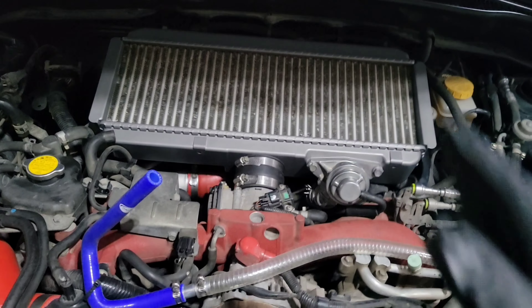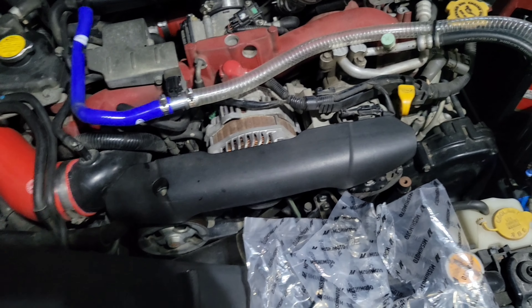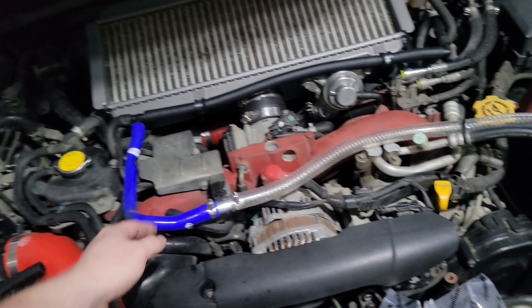Look how nice that looks compared to the rusty metal tubes. It looks really good and it's a very high quality hose from Mishimoto - it's half inch, comes with clips. I'll put the part number link in the description. It's just too bad they didn't send a little bit longer piece. This was about $22 Canadian shipped, so use that information however you see fit. I had to reuse one section because I got a 3/8 adapter instead of a half-inch, but this will eventually go there and complete the whole setup.